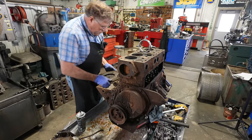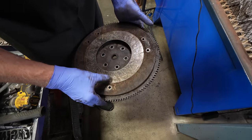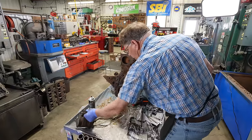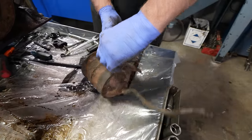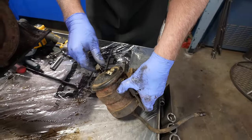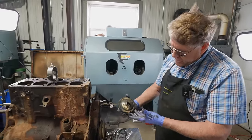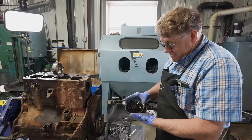I think this flywheel we can go ahead and put in the oven, bake it, clean it also. Look at that — you can see where the clutch disc had sat there for so many years, it just kind of rusted in place. I'm sure that was stuck when they got ready to move the vehicle. The valve cover, we can go ahead and put that in the oven to bake it. I'm going to take this oil filter — that hose will need to be replaced. Let's take the filter out of the inside of it. Oh yeah, this is clear full of oil yet. I just took that filter canister out to dump that in our waste oil collection tank — such a filthy mess. It did not have a filter in there. They left the filter out. It was just a canister full of old oil and sludge. I'm not sure what the story was behind that.